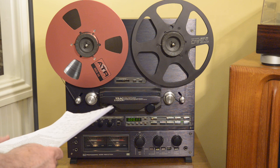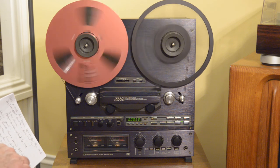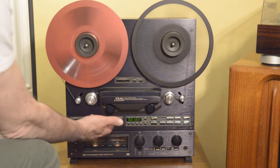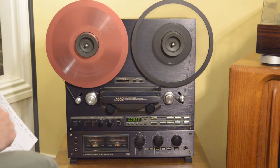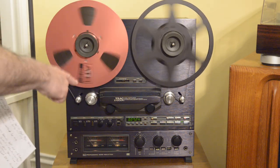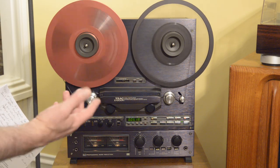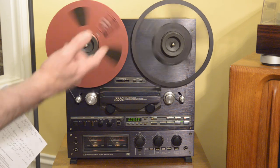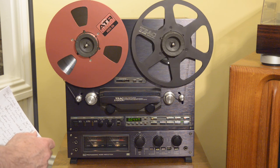A kind of hidden feature: if you press forward or reverse and then lift this up, you can hear what's on the tape going fast. When you let it go, it's setting the cue position. So now if I press set-to-cue, it'll go to the position where I released that. The idea is you're listening for the gap between pieces of music, and you let it go when you hear that gap.